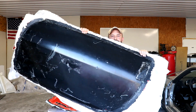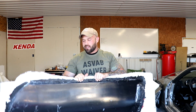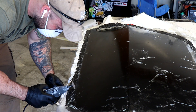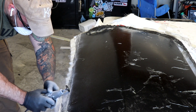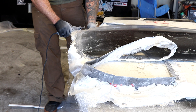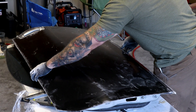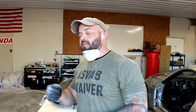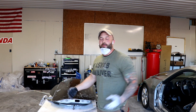Let's go ahead and take a look at it. It's pretty nifty — I think it looks pretty good. It's not perfect, but we never expected it to be. We'll be able to clean all the PVA off, trim it up to make it look nice, and test fit it against the door. And that, folks, is how you fabricate fiberglass parts. I'm going to trim it up a little bit more with the Dremel using a sanding tip to get it a little bit closer — it fits pretty okay. Now the 350Z community has bolt-on door skins. Hope you guys enjoyed the video. Like and subscribe.